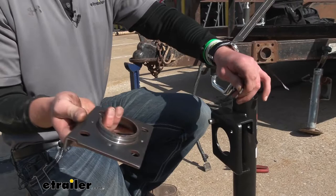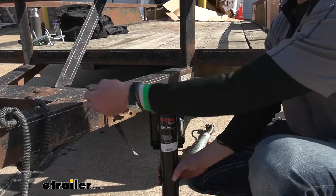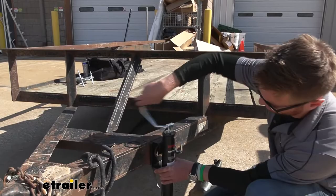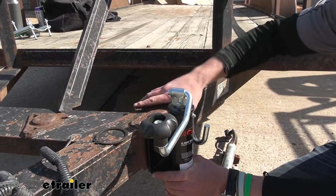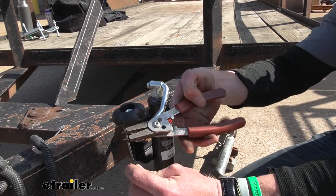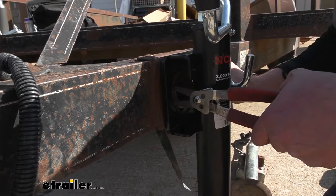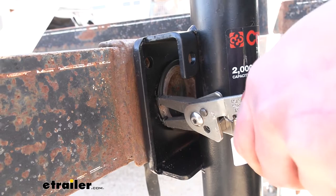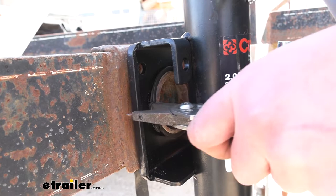Then you can either weld this or just toss it and use the existing one on your trailer. I usually like to take the jack, put it up like this, and at least just get the foot plate down to the ground. Make sure it's nice and flush to the bracket that's on our trailer, and then we can install our snap ring. You're going to need some snap ring pliers — just go in here like this, spread it out, slide it in, get the snap ring into place, and work it into that little groove on the back. Then take the tool and push it until it snaps into that little tiny groove.